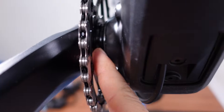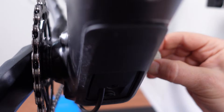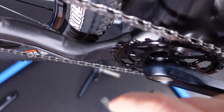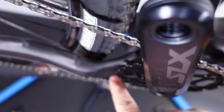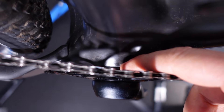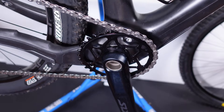Aside from installing one of these spacers on each side of the bottom bracket — and there is a rubbery face to it, make sure you put it against the bottom bracket — the installation of these crank arms is quite simple and I have it documented, I'll make sure to link it. You can see how the 55mm chain line versus 52mm gives me a lot more room on my bike, and how I can now install the oval where before I couldn't even dream about it. That 3mm spacer is installed on the drive side, only possible because the spindle of this crank is longer by 6mm.